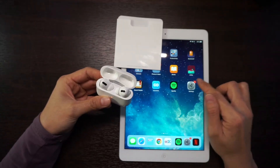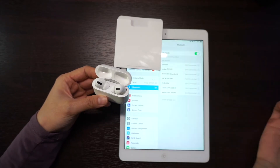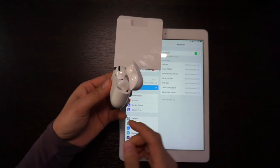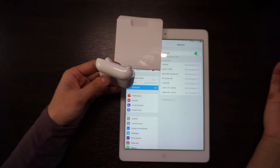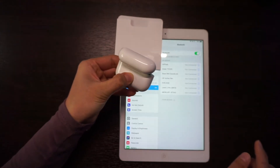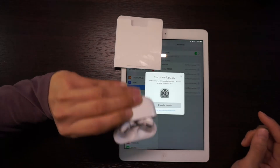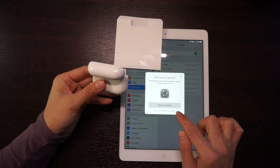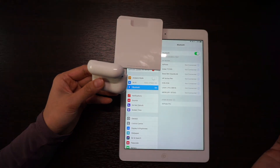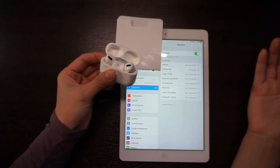For my older devices, it's a little bit more — just two extra steps maybe. I go to my settings, I turn on Bluetooth, and I try to find it. It's not picking it up, so let's open the AirPods next to my device and click on the button at the back. You hold it until it starts to blink. There it is — let's check for updates first. There it is, you tap on it and that's it, you're done.